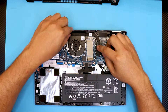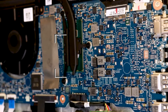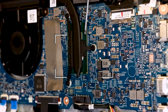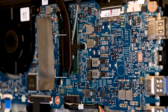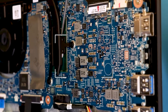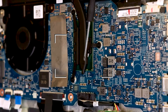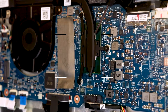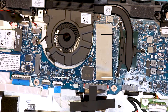These are the worst X-clamps ever. If you pay attention, you can see that the second die over here is not even touching the heat sink — it's not even close to the copper heat sink at the bottom. There's about one to two millimeters of space right there. The main die is touching, but the second die has a gap.